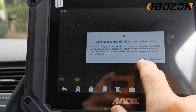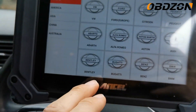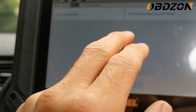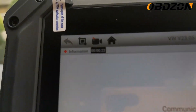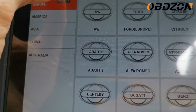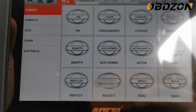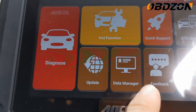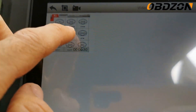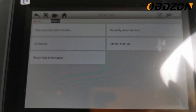This is really useful for diagnostics — you can record what you're doing. Press the camera button and it starts recording the screen and audio. We're in a VW, going to special functions, tire pressure reset — and you can see the red recording indicator in the top left corner with the elapsed seconds. You stop recording by pressing the camera button again. You can also take screenshots, which is useful — the image saves to memory. In the data manager you'll find your images, reports, and videos, so you can record live diagnostics while driving and review them later.